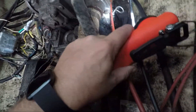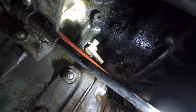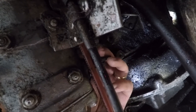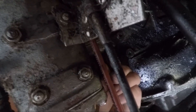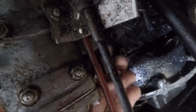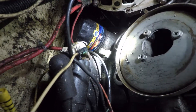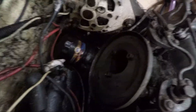It's going to be really difficult to see this drain cock right here — but that's it right there. That's the closed position, and this is supposedly the open position — either side. I've already drained it out so you can't really see it, but that's where it comes out. And on this side is the block drain — right there. It's already drained out as well; I've got it open so it can continue to drip any excess. Antifreeze did come out of both of them, so that was a plus — that means we actually got it done right.